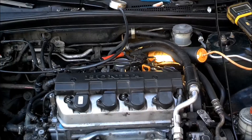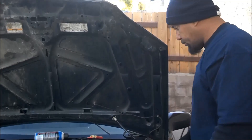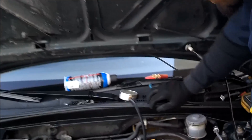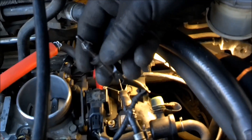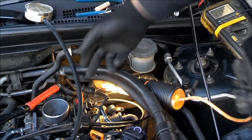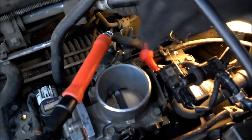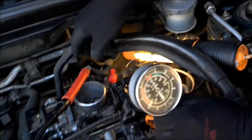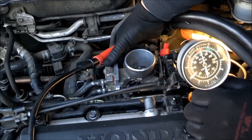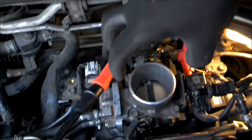All that's good so far. Now let's turn it on and warm it up. What we did is we took out the inlet air temperature sensor and removed it from the housing so we don't trigger a cold reading. We also blocked off that port since we won't get any vacuum there anyway. We hooked up to the vacuum right here — this vacuum is going directly to intake manifold vacuum, which is underneath this throttle plate.